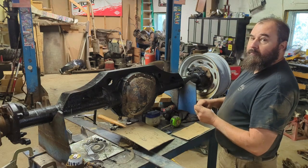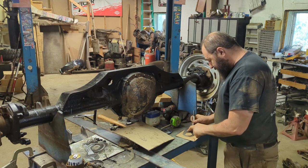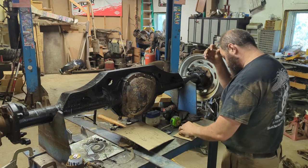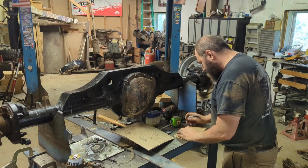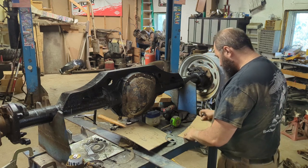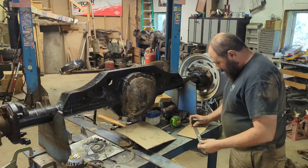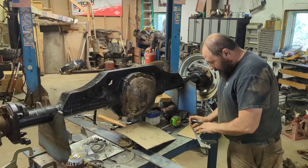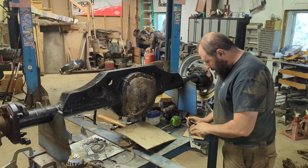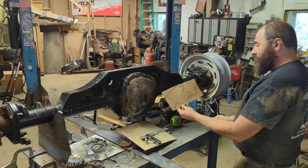So now we just need to add some material and tie that all together. I'll grab my 911 Motorsports plasma template and I think that gives me a pretty good radius up top to make sure I have enough meat for strength. Actually that's probably a little big - I'm gonna come in a quarter of an inch on that, roughly. I'm going to take my straight edge and draw a line down to my tube, and then do the same up top. That is the bare minimum of my shock mount - super simple, but I think it's gonna do its job.